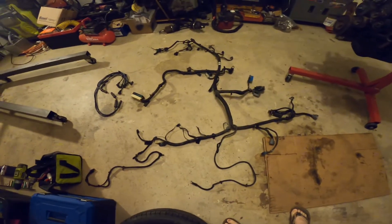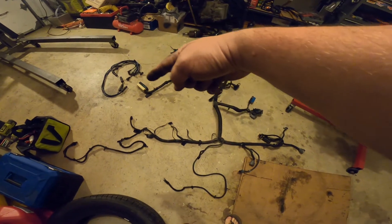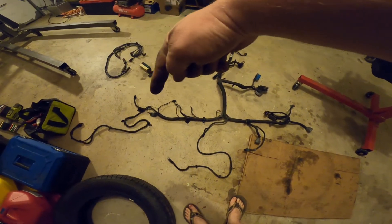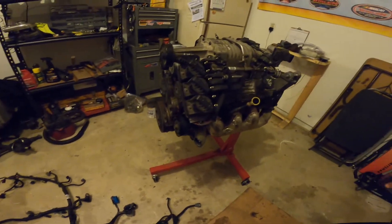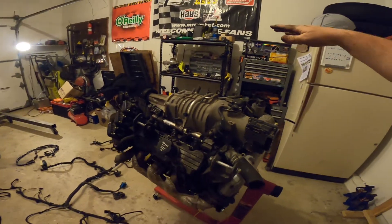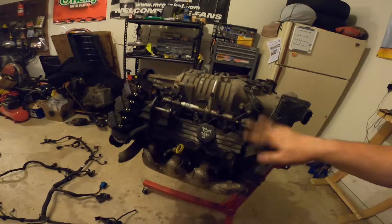The harness is off. I tried laying it out the way it sits on the engine — PCM connection up here, this is kind of where it runs around the back side of the engine to the alternator, this is where it runs over to the fuse box, and then down here across the bottom of the front of the engine down to the wheel speed sensor, air conditioner, starter, down to the other wheel speed sensor. I left the ignition module connected for now just because that's all going to come off when I start pulling the pulley system apart and pull the coil bracket off. The idea is to get to a point where the fuel rail is out of the way, EGR is out of the way, and I can then go to taking the supercharger off and the lower intake off — because I will be moving to the turbo setup. Whether it goes to the Holley intake or I go back to my L26 intake manifold, I'll be able to put my head studs in.